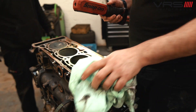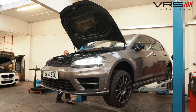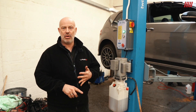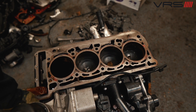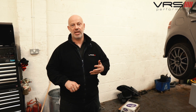That's going to be a phone call I need to make to Sarah. This is a stage three car and the customer has got a melted piston or a blown engine. We built this car about four and a half, five years ago now, and it's been fine until now obviously. This car runs on meth and octane booster. When we got the car in, we noticed he'd had the head taken off at another garage. If you look at the pistons, they're just black — which is fine on a normal engine, but if you run an engine with octane booster and meth, they'd be orange, not black. So we found that the meth tank was empty. The customer's been running the car with no octane booster and with the meth empty, which in turn fried number one piston and killed the engine. He's had an expensive lesson, but a second-hand engine has been put in — still a stock engine — and it's been all right for four years, so it should be all right again.